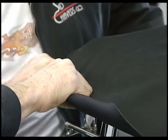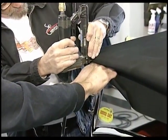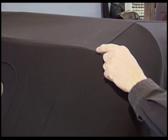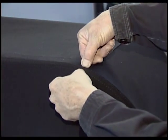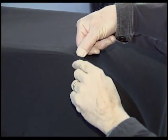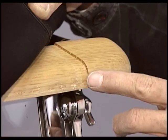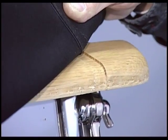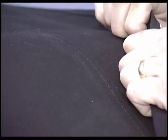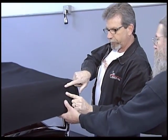We do both seams first. What I was checking when he was pulling was that the seam going forward and the seam over the back were lined up on the center of the bow. Don't worry about the sides yet — we'll deal with those in a minute. When you get to the other side, it looks like the seam is not quite in the same place as the cutout in the bow — it is. It's made to pull to the side just a little bit. So you pull it tight and a little to the side, and it'll fall right in there. It's made that way so you're pulling the top a little side to side.